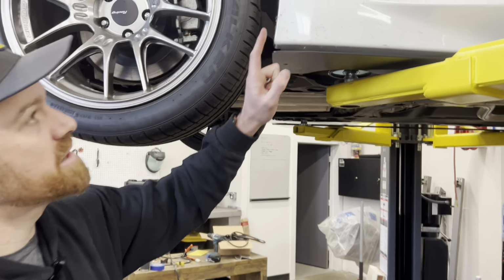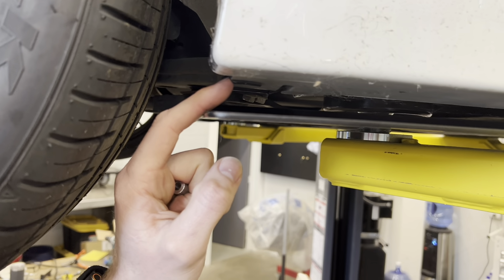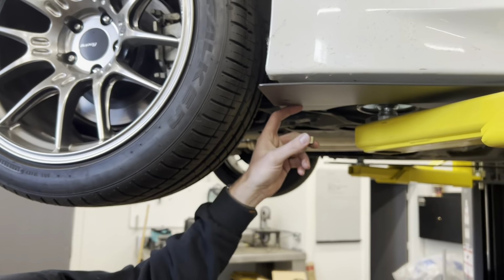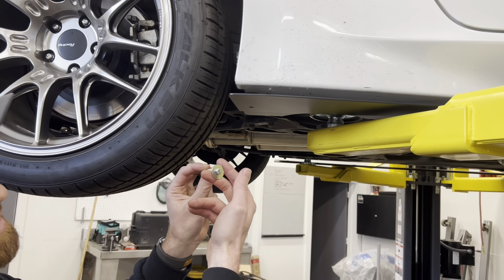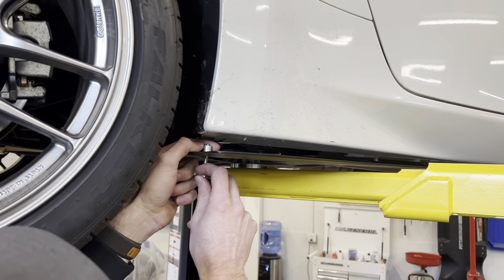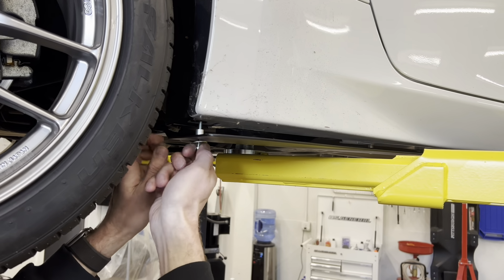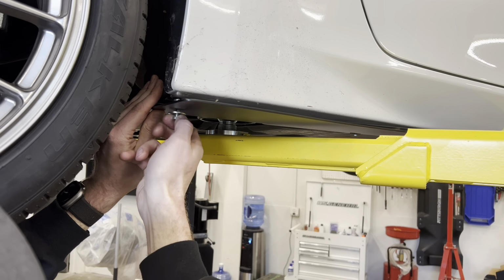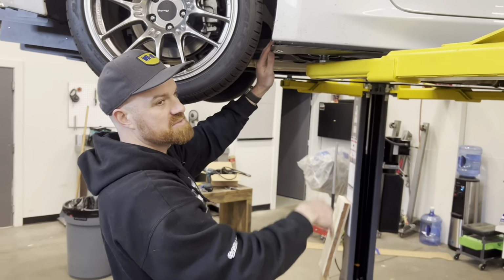Okay, so now we've moved to the outside rear, and up here is where we've already drilled the hole in the plastic and put our U-nut right here, and that's just to give it a little extra rigidity on this outside edge. And because of our joggle that we've put in here, we're going to use one of these 1/2-inch spacers. We're using one of the M6 by 50. It's a little longer than we need it, but there's nothing on the top side to interfere. So I'm going to slide that in with that single spacer and go ahead and get it threaded into that U-nut that we have. And again, none of these are tight. I'm just getting them all started in position, and then once we have the rest of the hardware in, we'll go through the process of tightening it all down.